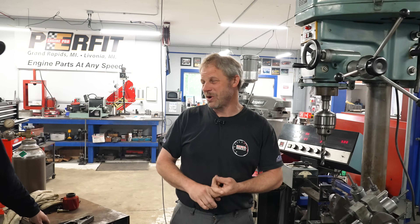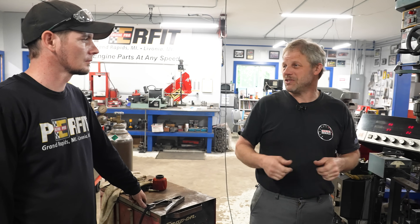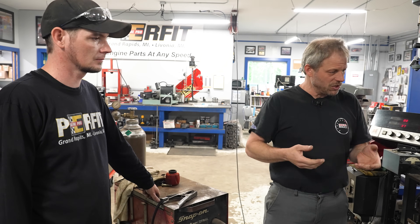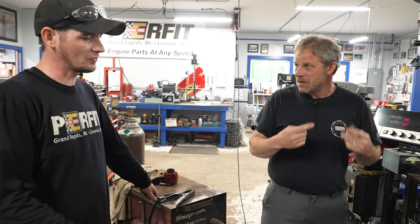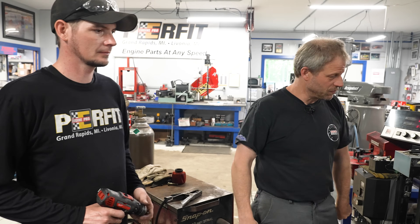Crankshaft's done. We're ready - just the cleanup, we're going to dust off the oil and all that. Unfortunately, my balancer's not ready yet from a coating standpoint, and neither is the flex plate. So I'll send that to you to zero balance it - you'll spin it. John has a special fixture for flex plates, flywheels, and balancers - just make sure it doesn't have a heavy spot on one side, truly like a tire.